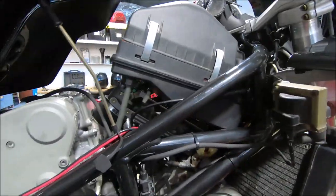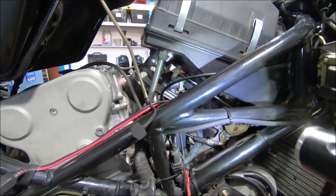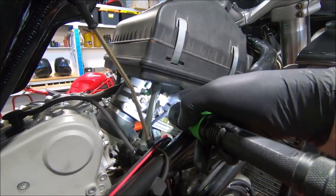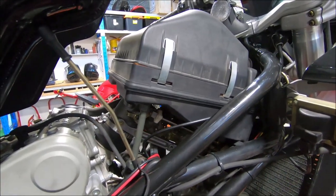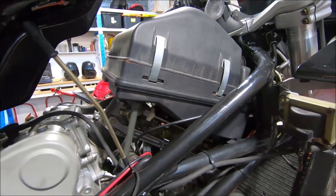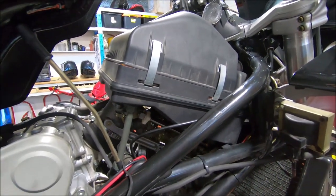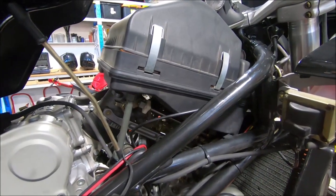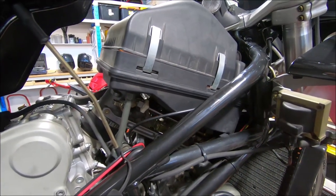Back to this side of the bike. The things we're going to be using today when we adjust things: this big white screw, or white thumb wheel, you might call it, is what we use to adjust the balance. I might call it the running balance or the synchronization between the two cylinders. And that's just the adjustment for running at, you know, 2, 3, 4, 5,000 RPM. It's always a compromise. Some models, the compromise is less than others. These are usually pretty good. 749s and 999s can be particularly bad. It's just the way it is.